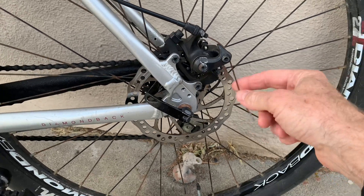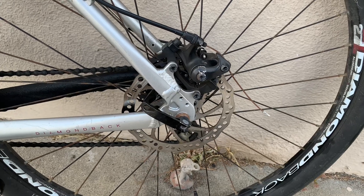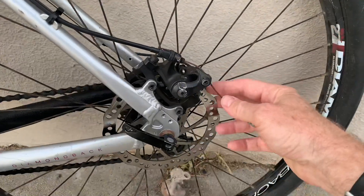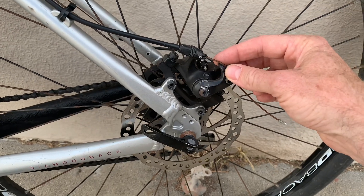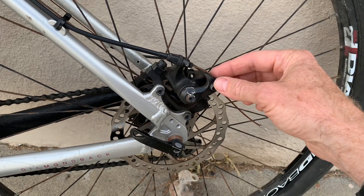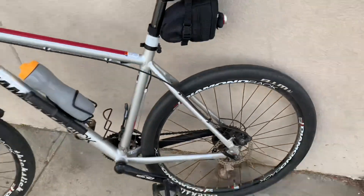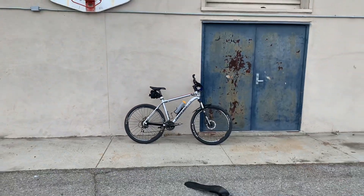If you're buying a new bike it'll most likely come with disc brakes — either cable-actuated mechanical or hydraulic with fluid. This is controversial and people have disagreed with me online, but I like mechanical brakes better, especially if you just want something reliable. There's a little more lever effort required, but it's not unreasonably hard. The trade-off of reliability and cheapness of mechanical brakes versus a cheap hydraulic setup is really night and day. When hydraulic brakes get air bubbles in them you can't stop, or you have to pump repeatedly for any stopping power. For a reliable, cheap commuter beater, I'd go with mechanical disc brakes.